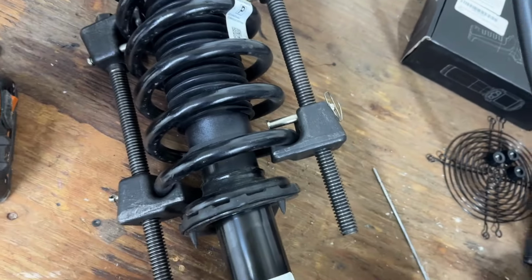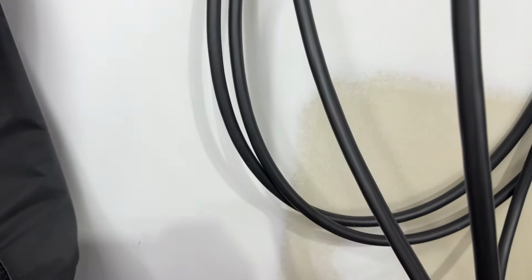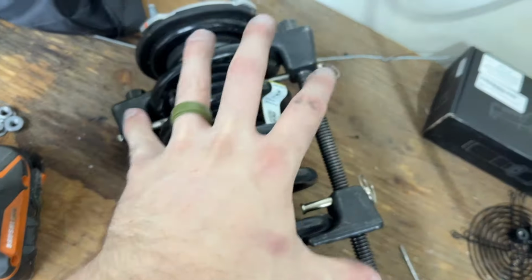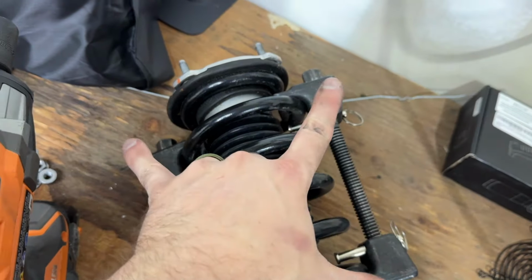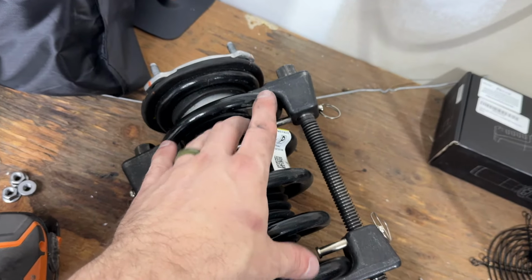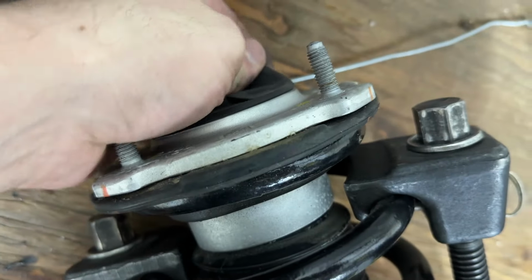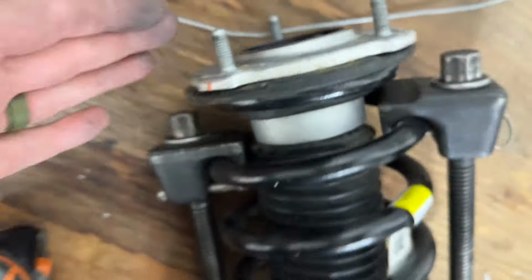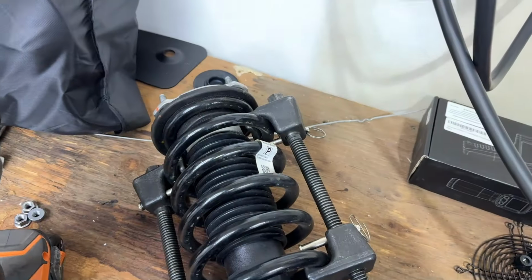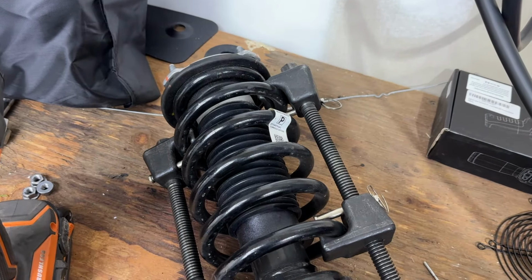All right, now we got them on. I've got it facing away from anything important. I guess the house. Anyway, I've got it on opposite sides. I've got them nice and snugged on there, and I'm gonna start tightening them one at a time, just enough to start to get that tension. So when I take this off, pop, up at the top, and I take that nut out, it won't fly out with the deadly force of Springmageddon.